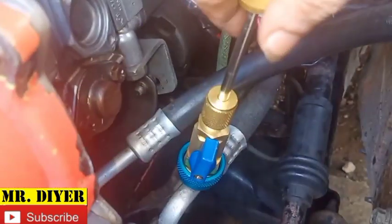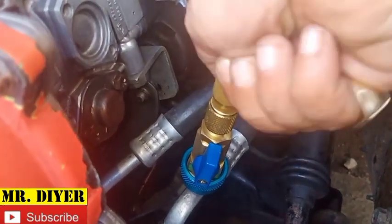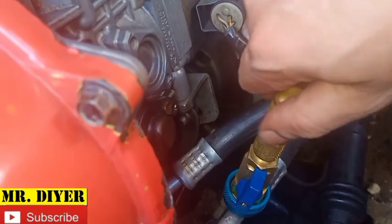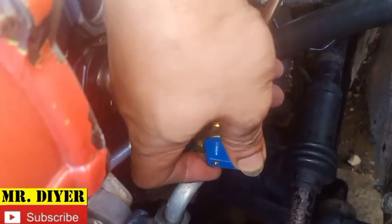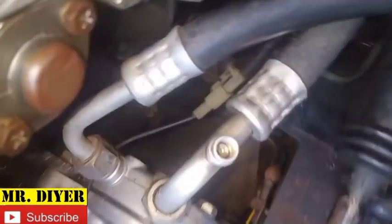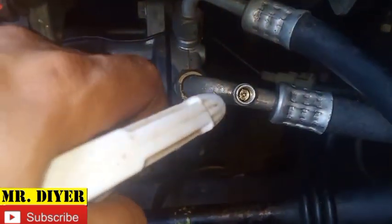Screw the cup back on. Now like I've said, once we open this it's going to apply pressure. Push it and turn, turn, turn — already screwed in, just finger tight. Then pull the tool out, lock this, and pull this up. There's our new Schrader valve.